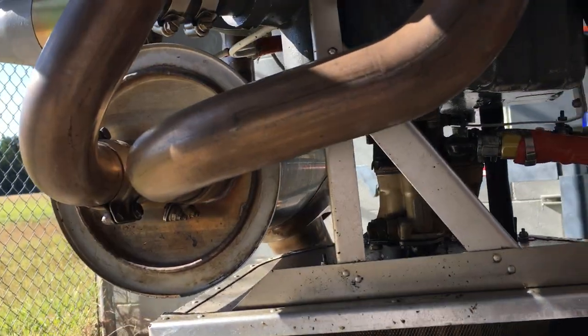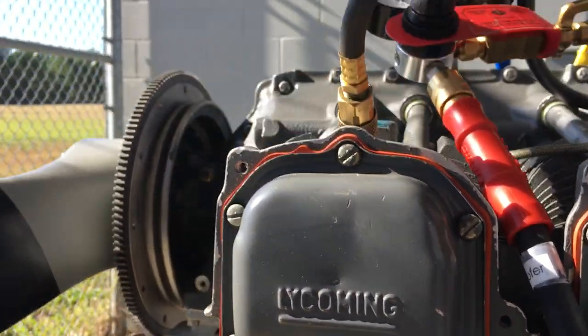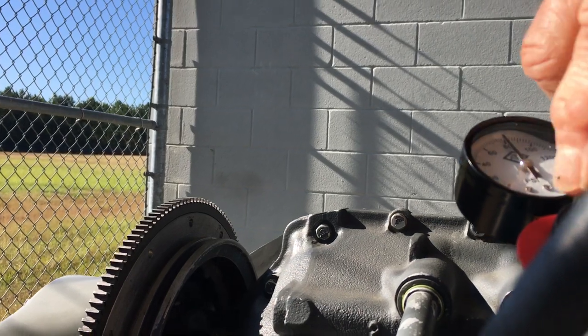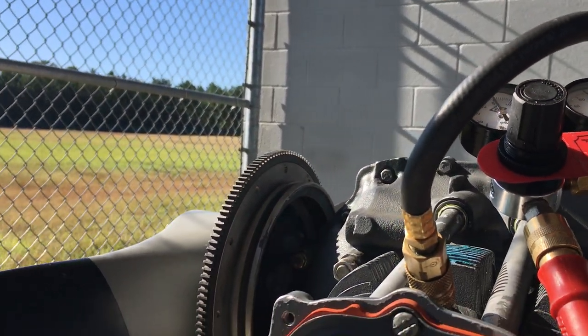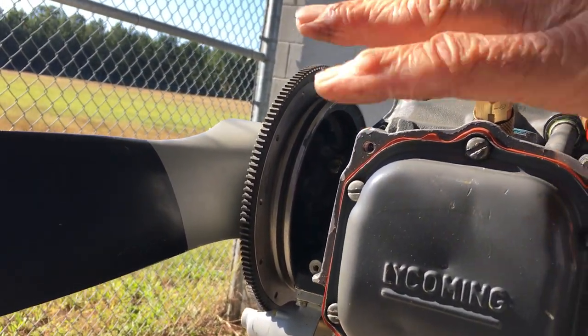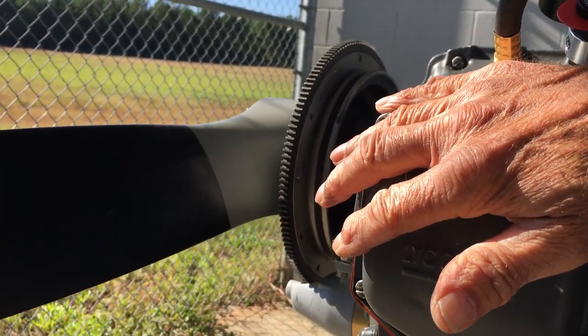Our valves are good. Our leak is the rings. Intake valve is good, exhaust valve is good — our leak is occurring with the rings. And 70 over 80 is a normal reading, so this cylinder does pass. It's a good cylinder.